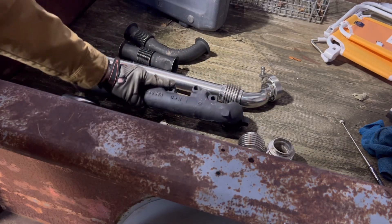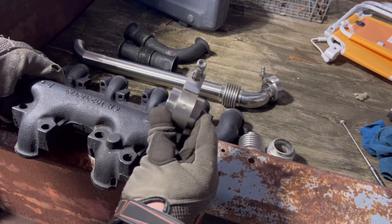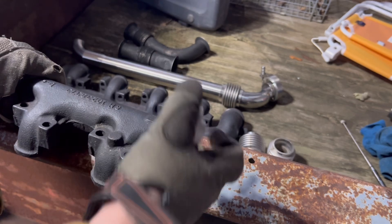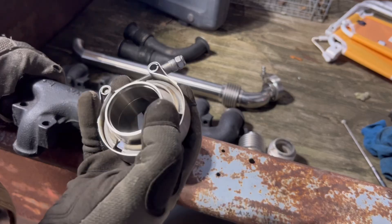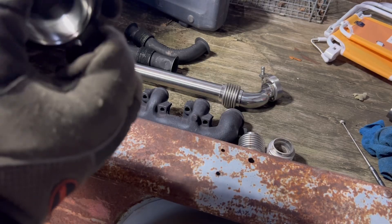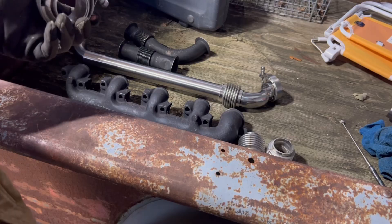The V-band off of this side — I am mildly nervous doing it, because you really don't get a whole lot of meat here. You basically get one shot to screw this up. So I'll probably have to cut it off with a sawzall right at the edge of this flange, clean it out with a Dremel, make sure this is going to fit, press it in there when it's warm, and then weld exterior to make sure that I'm not going to have anything walking on me when we build boost or pressure and heat.